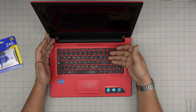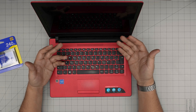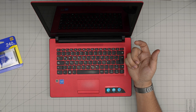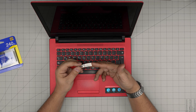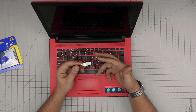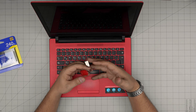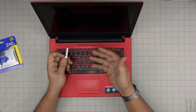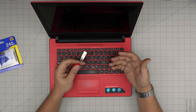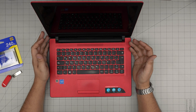Just remember, by replacing your main drive with a new drive you will not have any operating system on the new drive, so as soon as you boot it will say there's no operating system. I made a video on how to create your Windows 10 or Windows 11 USB boot drive — check that link in the video description. I also made another video on how to install it properly on any Lenovo laptop so you don't get extra bloatware like Candy Crush, affiliated programs, and antivirus stuff installed.